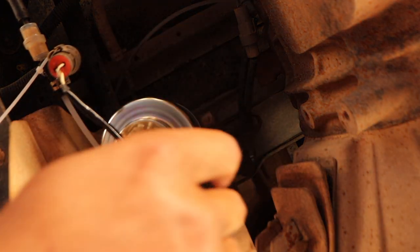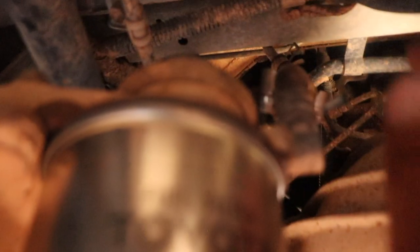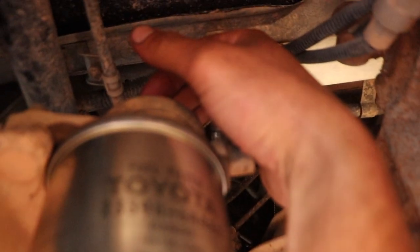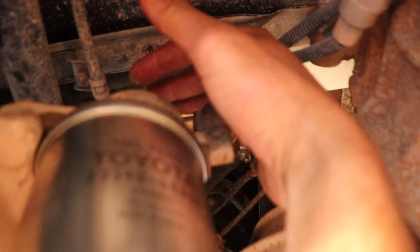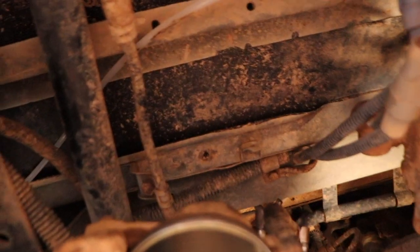This is just done up hand tight. Then reach up on top — just up here you feel there's a plunger and all you do is just plunge away on that until it gets stiff enough that you can't press it down, and then that'll be it — pre-primed. I've given it about a good hundred or so primes, it's getting pretty firm, so we'll start her up.